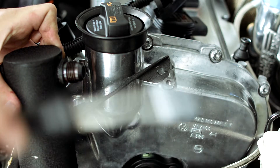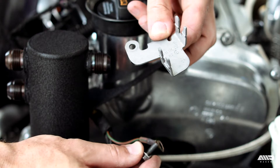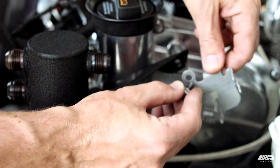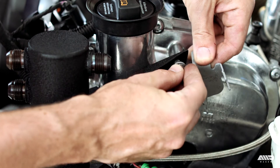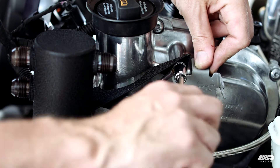We're ready to mount the catch can. First, use the 10 mil bolt and the forward position of the oil filler neck to secure the front of the can to the timing cover. Next, thread the bolt through the ground wire first, then through the bracket, and finally through the catch can mount and into the timing cover.